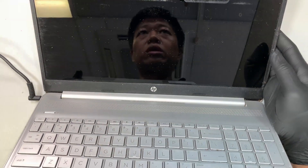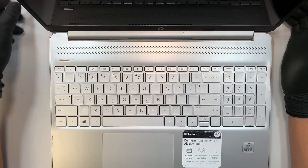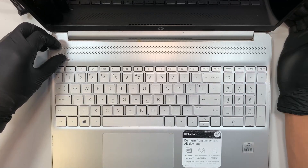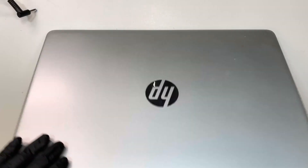So if you have the same indicator on your caps lock — three long beeps and two short beeps — and you have no display on your screen, let's go ahead and try to troubleshoot the laptop together. First I need to pull the power and make sure my laptop is turned off, so I'm going to press and hold the power button until it goes away. All right, so now the laptop is completely off. Turn it around.